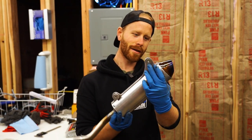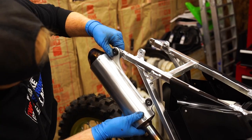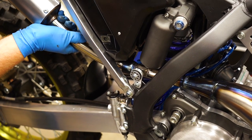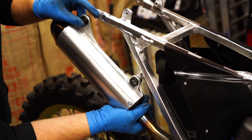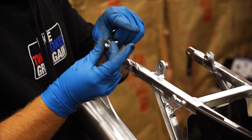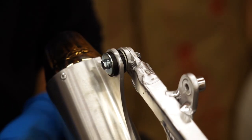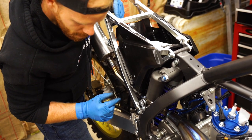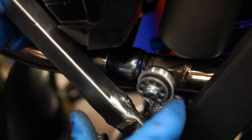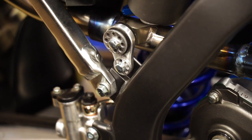You guys ready for this spicy little thing? Now I don't have the rubber that goes between the pipe and the silencer, so we're just going to have to put that on later. That is sweet. I noticed the silencer doesn't really go all the way into the pipe here — it's supposed to go in like that but the holes won't line up. For now I'm just going to use one of these basic flat washers. Whenever I'm putting an exhaust system on I leave everything loose, make sure everything lines up. The pipe and silencer don't really mesh together too well, so while everything is loose I'm going to push it together and then tighten it — that will help eat up that gap.